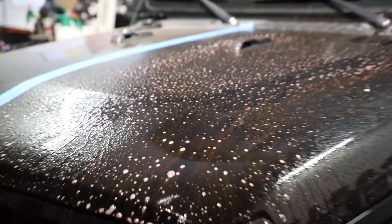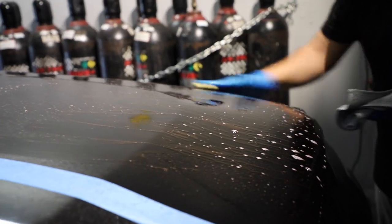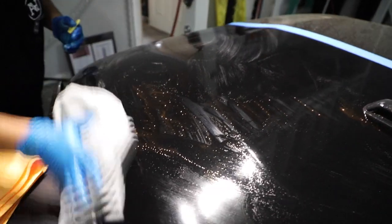In order to produce elite, top, high-quality work, you need the best tools in the detailing game. You cannot be half-committed to investing in only a $100 buffer just because it's cheaper. Here at A&A, we're all about the customers. Step one is to wash the car and remove that top layer of dirt. Since we're in a shop, we hit it with a waterless wash — it's eco-friendly, easier, and less of a mess. We applied it and wiped it off with a towel. It's important to remove that first layer of dirt because the next step is clay barring the vehicle, and clay barring a dirty car will just scratch and damage the paint instead of smoothing it out.